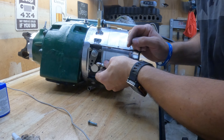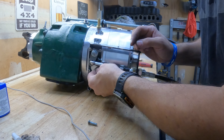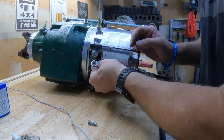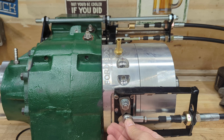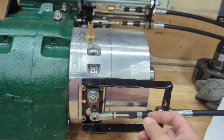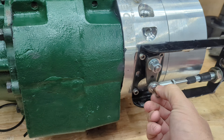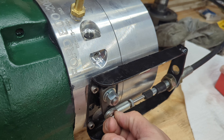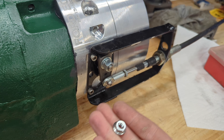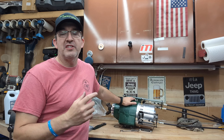Now I'm going to get the shaft put in, but I don't want to forget my spur washer. I want to try the bottom hole — I think that is where I want to start. A lot of powder coating is just taking up a little bit of space. I'm going to thread on this heim and bottom it out if I can — alright, it's bottomed out, good. So we've got the last piece going on — the doubler case itself — we're going to attach the reduction box to the cable. I have a 1/4-20 button-head cap bolt about 3/4 of an inch, feed it through. The kit I bought was used so I don't have the exact bolt, but I'm going to use this 1/4-20 bolt with this really narrow nut, blue Loctite it in, tighten it down, and we should be good to go. That's going to do it for our doubler build.